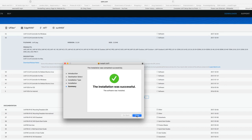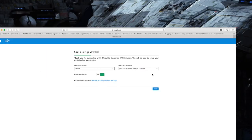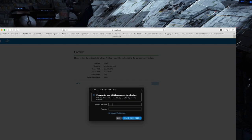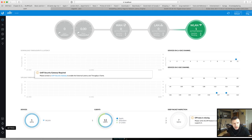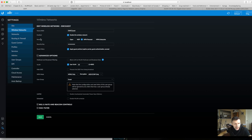Now we'll have to download and install the UniFi controller from the Ubiquiti website. The access point is currently not found so I have to reset it again as it was already discovered on the iPhone. Follow the configuration steps to complete the setup. Skip the cloud plugin for now. This is my UniFi interface, so I'm going to log in. Now we need to get some settings done on the UniFi side to make sure VLAN 10 is recognized as a guest network.